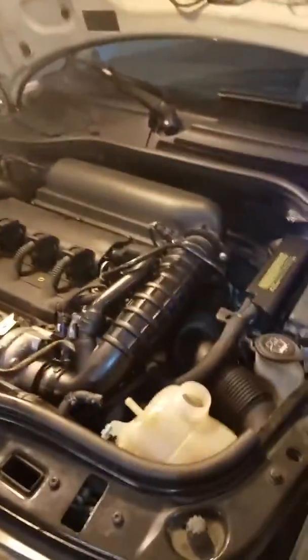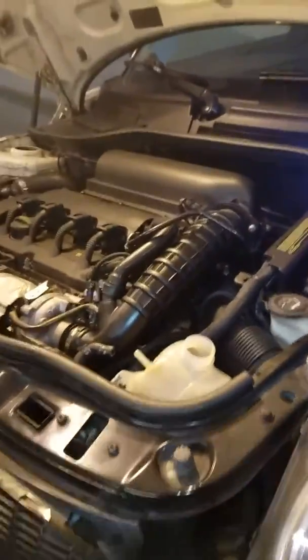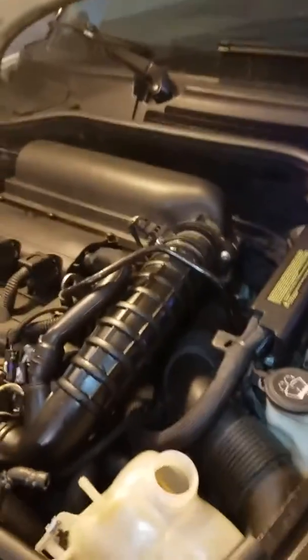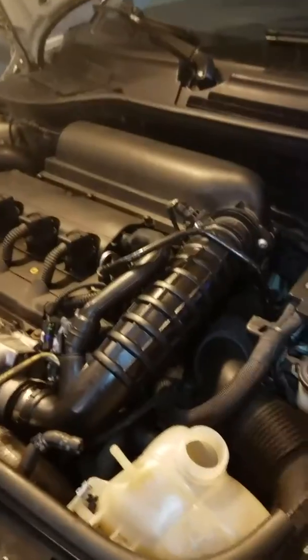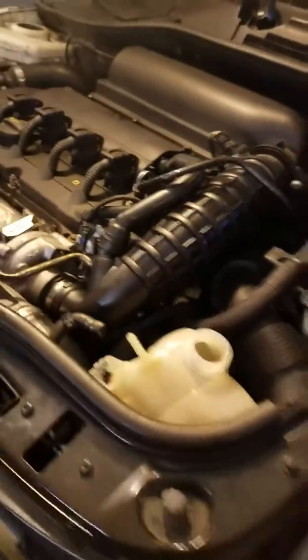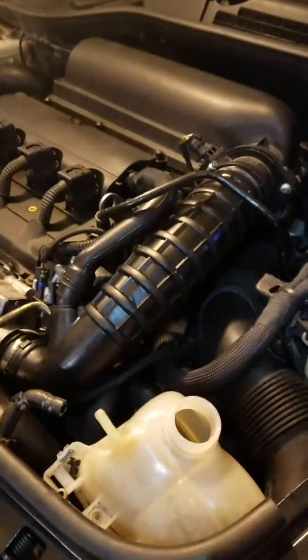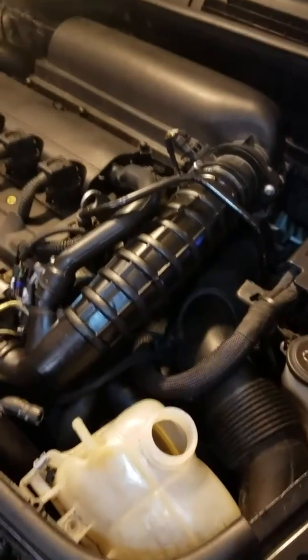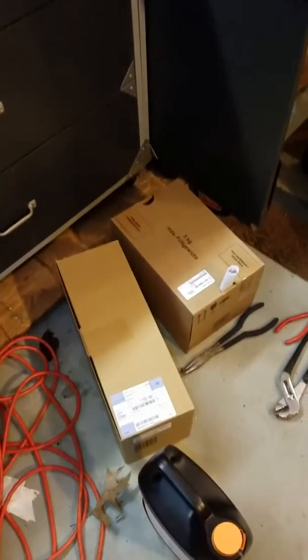Okay, today we have a 2009 Mini Cooper S Turbo. Turbo's right there. And we've been having a cooling problem. We're going to switch out and put another thermostat in here because the original thermostat, which is aftermarket, is throwing engine codes. And supposedly there was an issue with some of them that they're real sensitive, and only the original equipment manufacturer thermostat housings work properly, so I went ahead and bought a new thermostat and we're going to put that on here today.